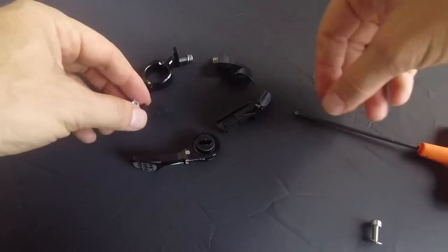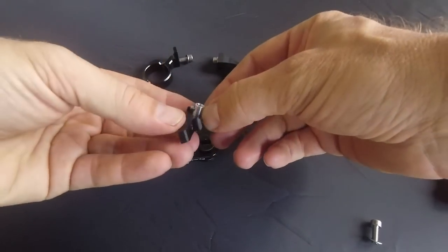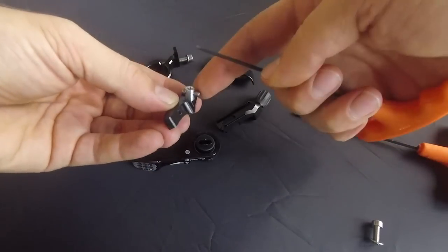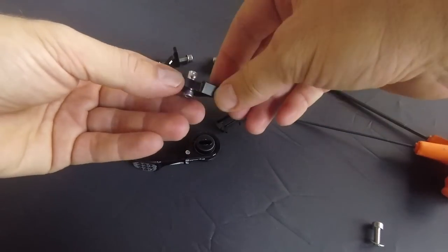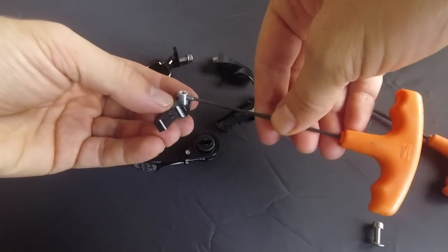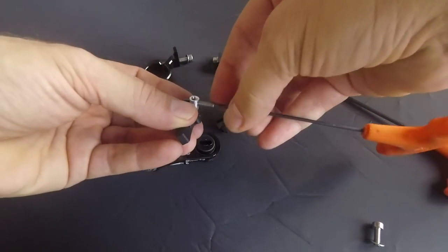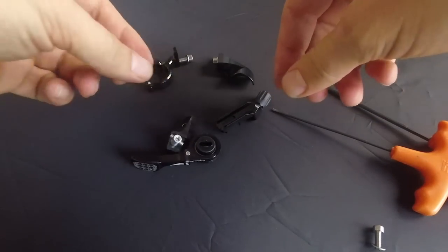The only other tool I'm going to need for this iSpec B installation - this grub screw over here uses a 2mm Allen key, so when I install this onto the bar clamp of my brake I'm going to need that 2mm Allen key. There is no Loctite installed on any of these screws. The torque is 2.5 Nm, which is not a whole lot. Most probably when I install them I'm going to put a tiny bit of blue Loctite on them just to make sure they don't come undone.